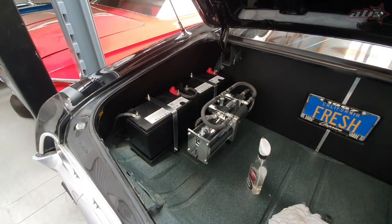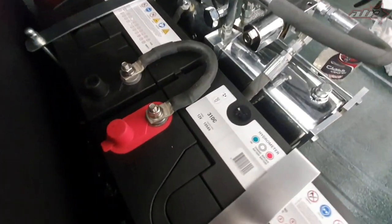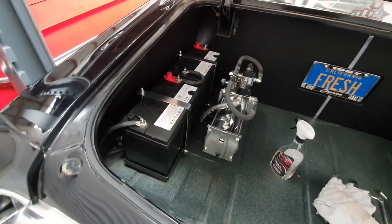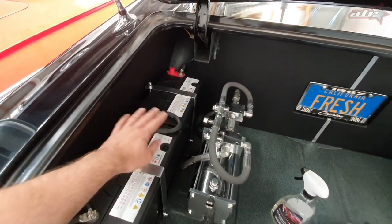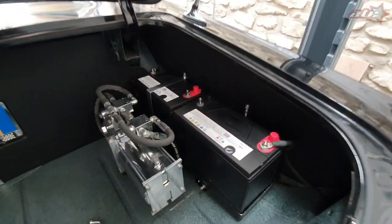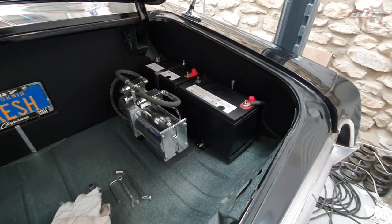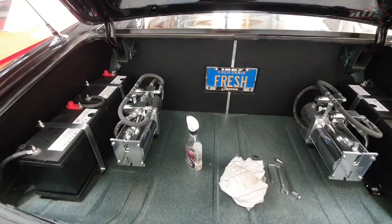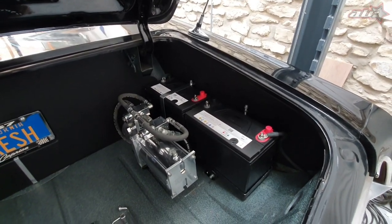The solenoids were all good, so we started mounting the new batteries — Dynec 12V 105Ah. We can find these in Europe and they're the same size as a Group 31 or 30 used in the US, with two pole options, which is nice. I did a test loop wire and tried the setup — everything is working. The only issue we had was the battery acid had corroded the ground for the dumps, and that's why the car wouldn't go down.